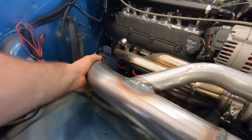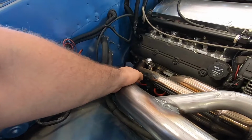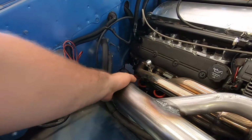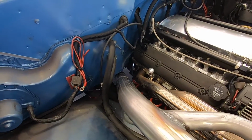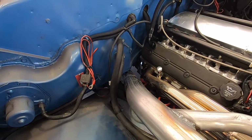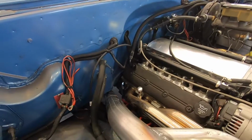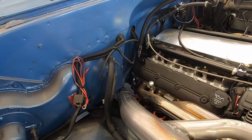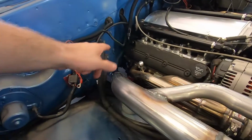This thing here has a bracket down on the transmission, and so that means this whole thing rotates with the engine. There's going to be a flex coupler right after that mount that the exhaust will hinge on, because the exhaust going back is going to be mounted to the truck frame with rubber hangers or whatever. So that's going to stay positioned when the engine is under load and flexing up here. So I'll need a flex joint for down there.